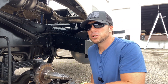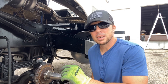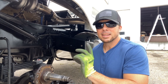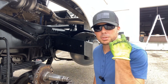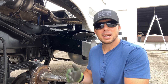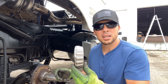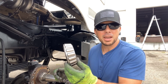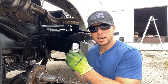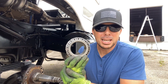There's a guy named Bill Ship — Ship Trucks, I think, up in Ridgeland. He's a really smart guy, big into front ends. He said this has actually happened to him before — he knew the serial numbers off the top of his head. He had a really good mechanic who had a couple seals blown out, brought the truck in, just changed the seals and put it back together without checking, and a mechanic had put the wrong bearings on. So it happens to other people. If your wheel seals go bad, always take the bearings out, put it on the spindle, and make sure you have a good fit. I hope that will save you from being an idiot like me.